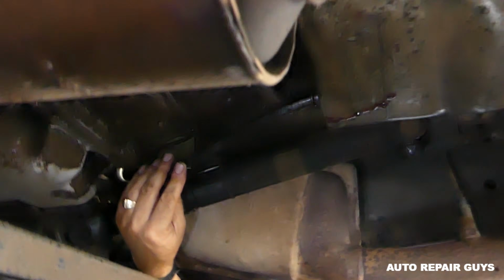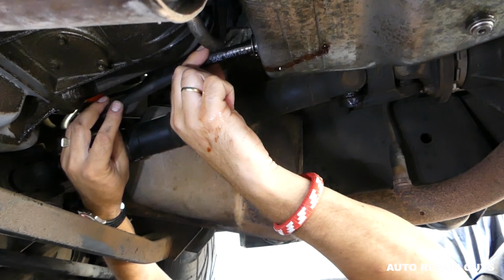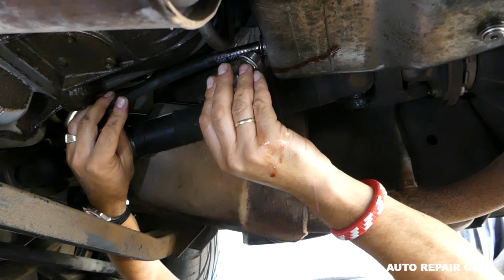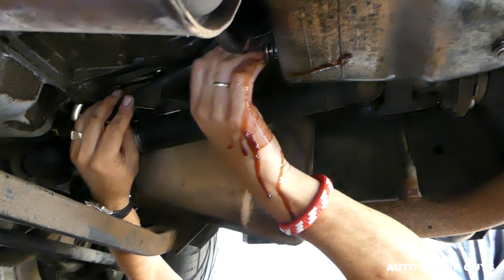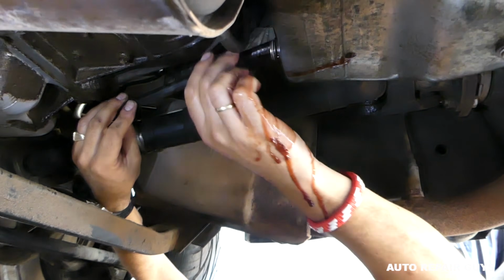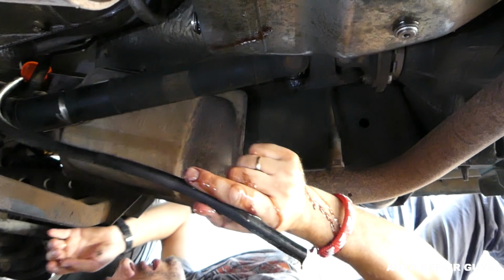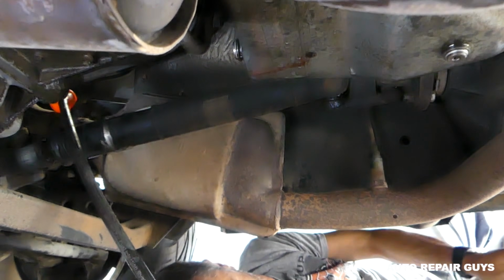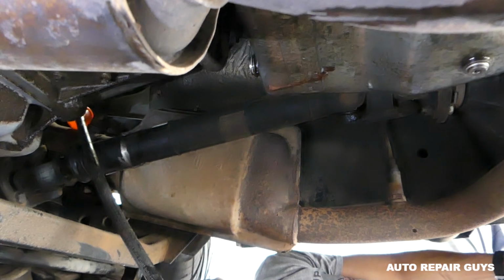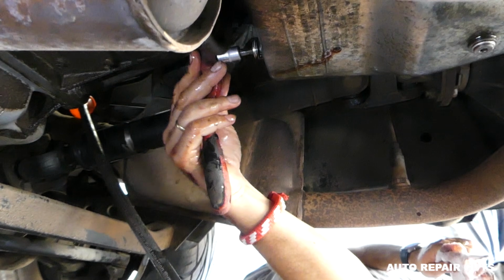Okay guys, so we added the oil, now it started leaking from the hose, you can see. When we pull it out, we might have even a little bit more, and we'll just go ahead and install the plug now. It's right where it's supposed to leak now. We probably have about 0.2 quarts more, because we have some in the hose. That will be the whole procedure, guys. You need to make sure that you drive it, go through all the gears and check it again. That's the check plug, and that will be all.